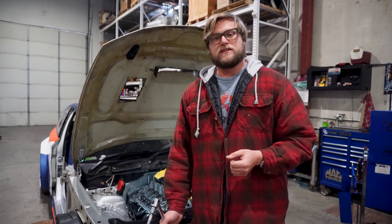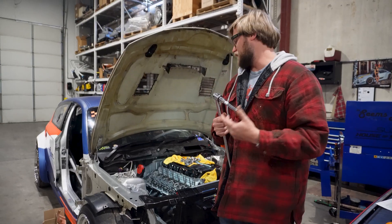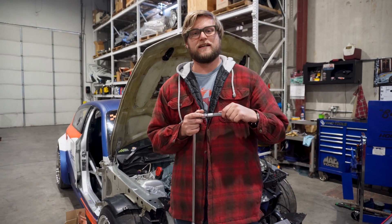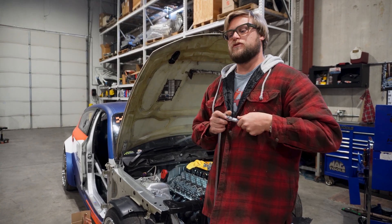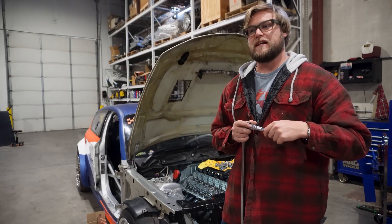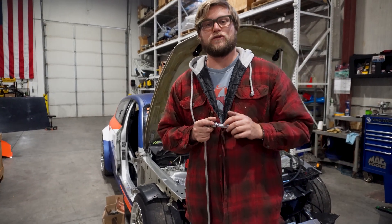So right now I talked to Mino over at Achilles who supplies these awesome cams and all my Supertech stuff. We're having to redo it all. I have all the valves out, I'm retorquing the head while I'm in there — the valves are in the head but I have the valve train out. I tested the springs to make sure they were correct and they were the 80-pound Supertechs I expected. On the dyno, it had a variance of lambda between bank 1 and bank 2. Our tuner Brendan thinks possibly the variance in valve lift actually created a difference in the amount of air being sucked in bank to bank, because the variances are crazy, all over the place. I did a leak down test thinking maybe something was wrong — leak down test was good. So that's the only thing left. It's another reason to monitor two banks versus one bank, you get a little more insight into what's going on.